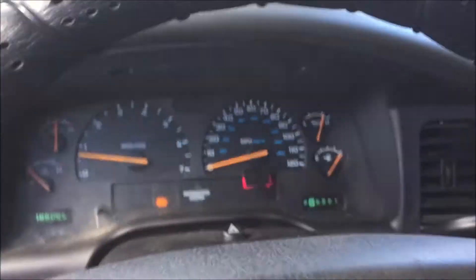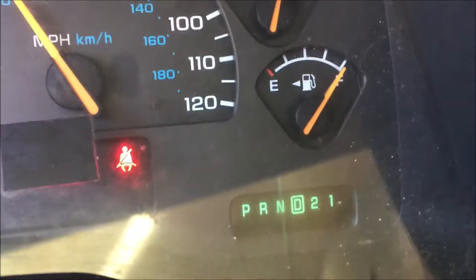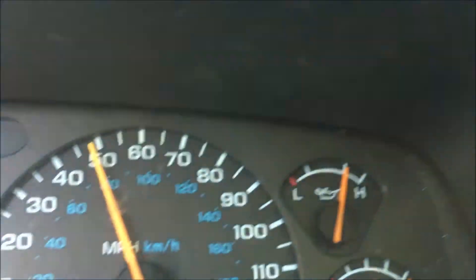Let's make sure it moves — very good. So we're driving it and it really does feel completely different. All the shift points feel different, it's smooth, it goes into drive to reverse quicker. When you floor it, it has a quicker lockup. I'm very happy with the job, but I was a little light on the fluid — I had about six and a half to seven quarts that I filled it up with, so I'm just gonna buy two more, put one more in real quick and then check it again. It definitely took close to seven or eight quarts.